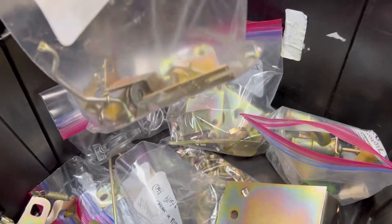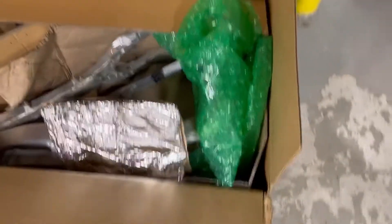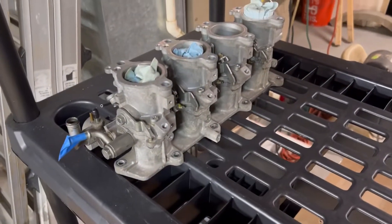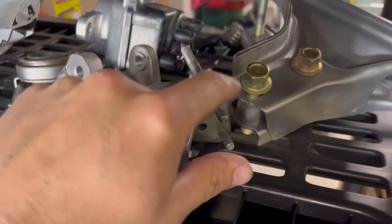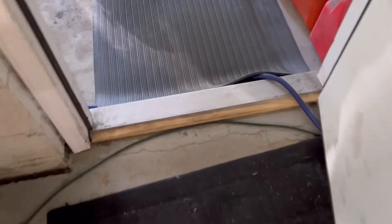I've been a little busy with the zinc plating and it's all looking really good. We've got some independent throttle bodies that will get vapor blasted and zinc plated. We've got another big bag of more zinc work to do — this is part of the Honda Civic job. I just yellow-zinced these bolts because they were pretty rusty. I didn't want him putting this thing back together with bolts that were already previously rusted — they'll look nice after vapor blasting but they'll just get rusted again right away.